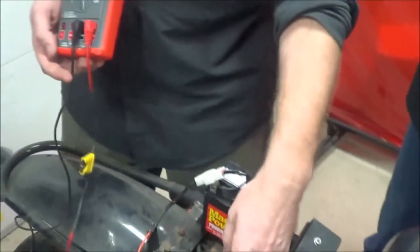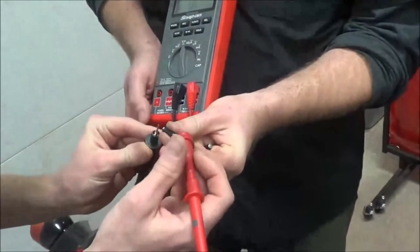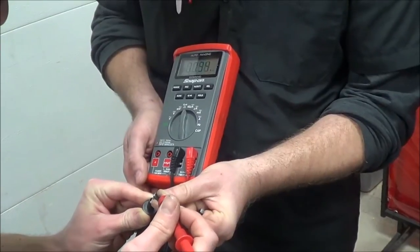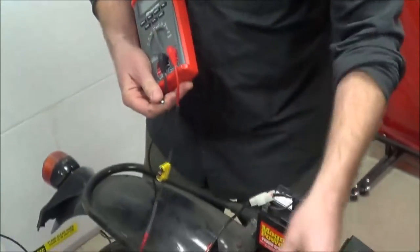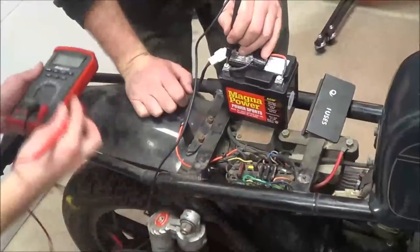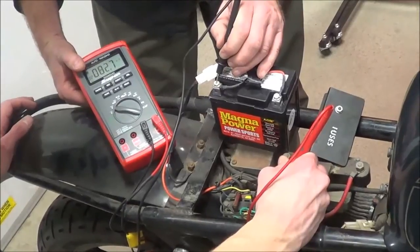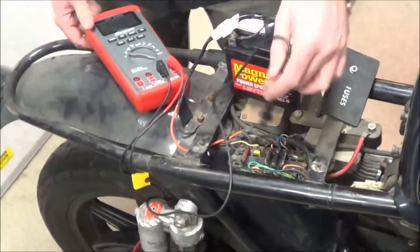It's kind of hard the way we're holding it, but what that tells us is there's a problem with the motorcycle, not the fuse. Here's that other fuse that we know allowed voltage to go through it. This fuse was originally said to be good — so I'm going to put this one back in. Switch back to volts and let's prove this fuse is good by testing voltage across there again. A little drop, but go across. The fuse itself is good — there's something wrong with the harness or the block.